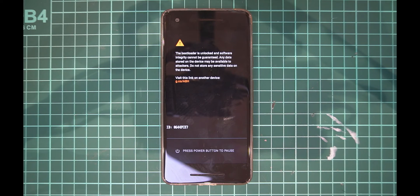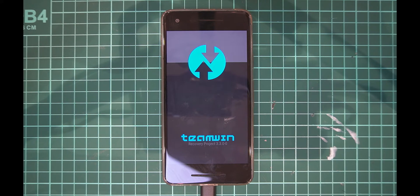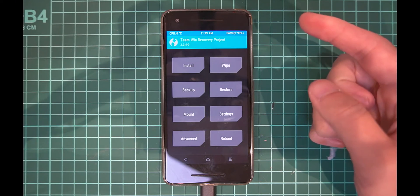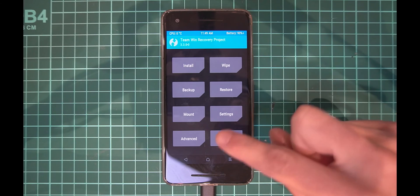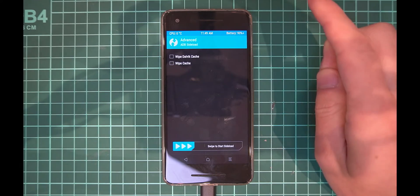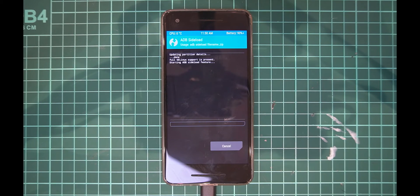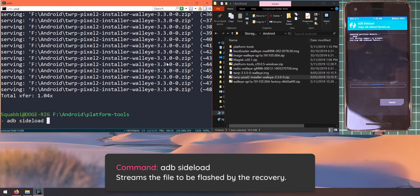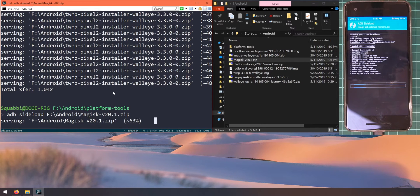You can always download the TWRP app from the Google Play Store anyway. The phone should reboot back into TWRP automatically. This version is the same as the one we booted from, so we still won't be able to decrypt the data partition — keep the system as read-only and go to Advanced, then tap ADB Sideload and swipe to start. Head back to the computer, type 'adb sideload', drag in the Magisk zip file, and hit Enter. Watch it stream over to the device and install.